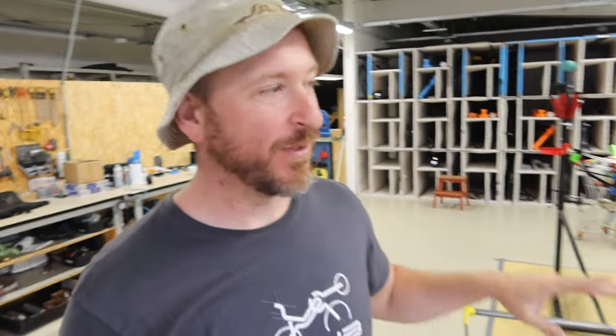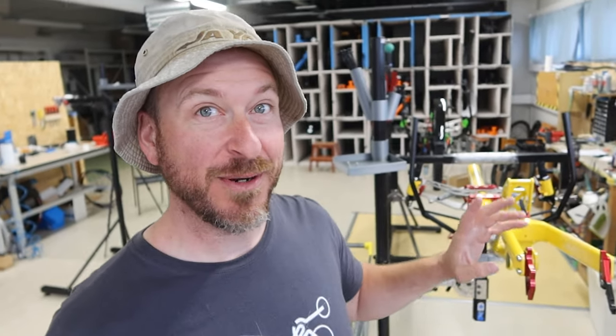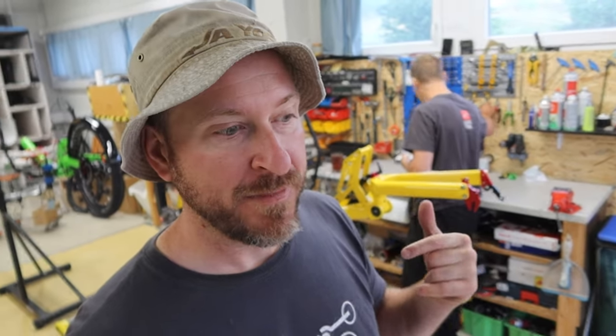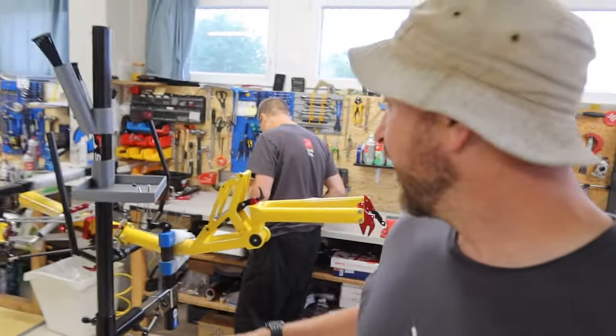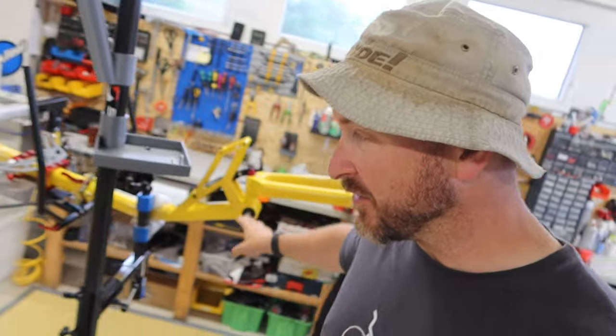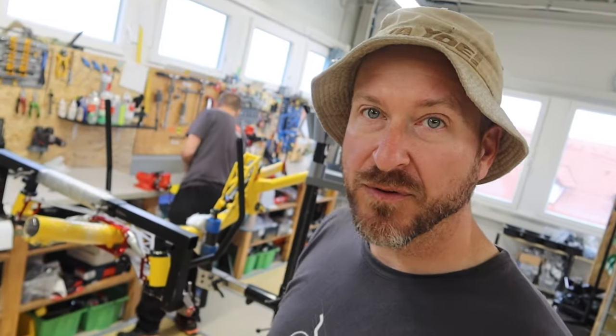So yesterday what we did was this. We finished the basic major components of the trike, except for the wheels. The wheels got to go on there. That's pretty major. But one of the things that I didn't mention about yesterday is that he asked me my height and weight, because it's important in adjusting the rear shock. The load is based on how much weight you're going to carry. So that was done. And also knowing my height makes a big difference in the build as well. How you elongate the front boom and a couple of details inside. So pretty cool. Yeah, he's like, how tall are you? How fat are you? He didn't say fat, but I interpreted that as fat.